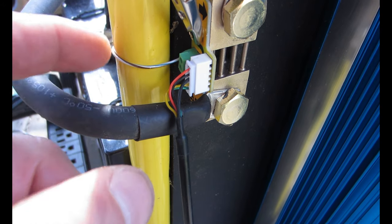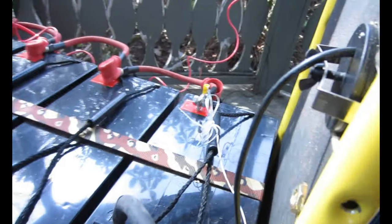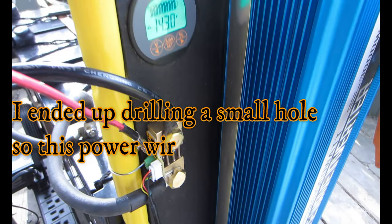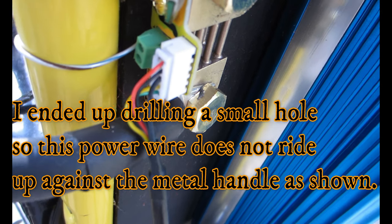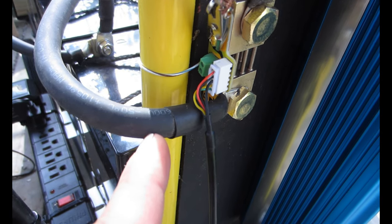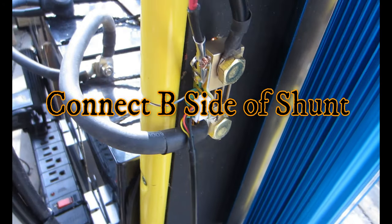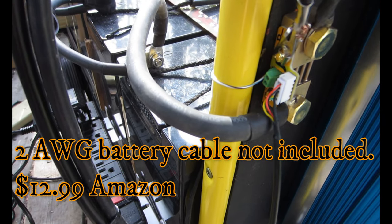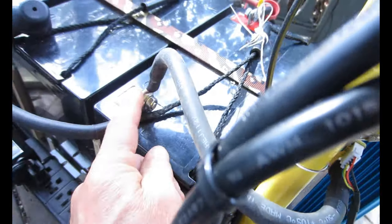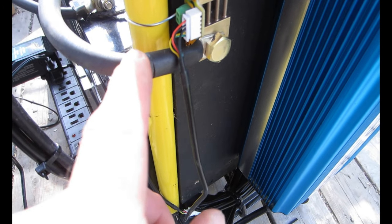I attached this small wire here which goes to the battery — it's a really small wire that plugs right into that green receptacle and goes over to my positive battery terminal. It doesn't take much to power this so it requires a really small wire. From the sampler or shunt, you want to go the B side of the shunt over to your negative battery terminal. There's a big two gauge piece of wire for that, and I had to drill out a bigger hole into the cable connector because the bolts on the shunt would not go through my battery terminals.